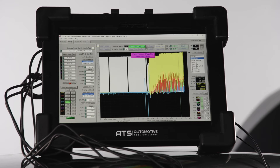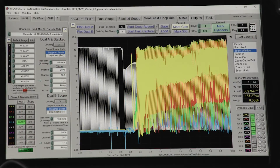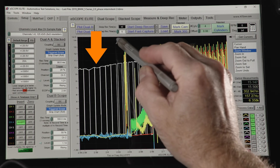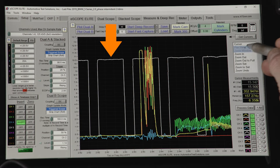Let's start the vehicle and record what's happening on the circuit. First, let's get the FPC control side or PWM signal out of the way. Key on, engine off — the PWM signal is at 2% duty cycle. There is no current to the pump, so all phases are quiet. When fuel pump startup begins, the PWM signal begins to switch duty cycle around 15 to 45%. Viewing the signal on my scope, it's a standard digital signal or a pulse train.